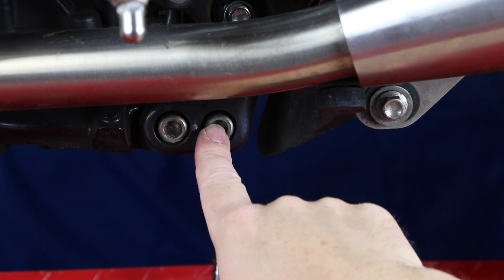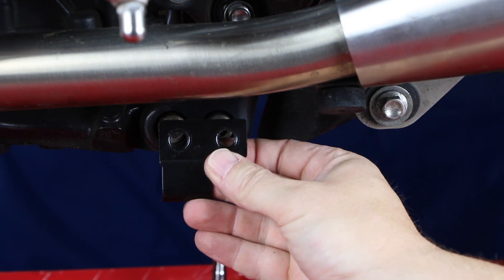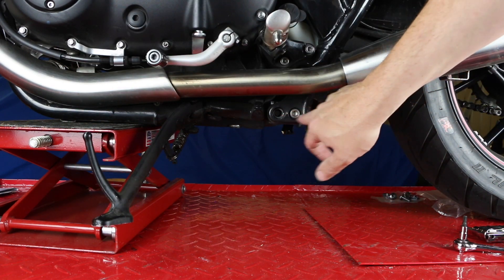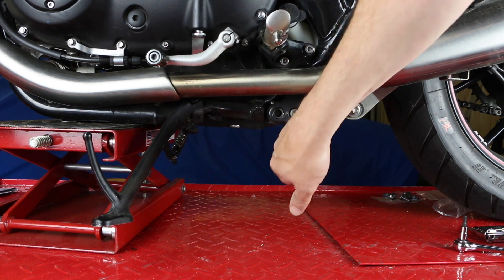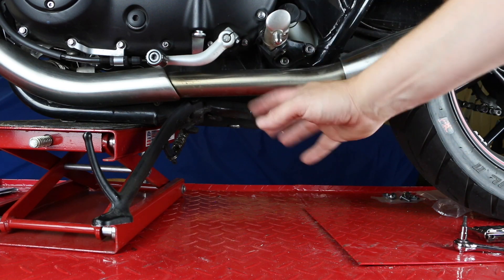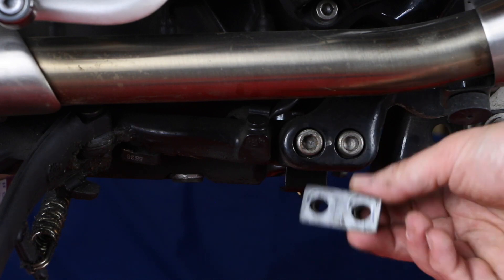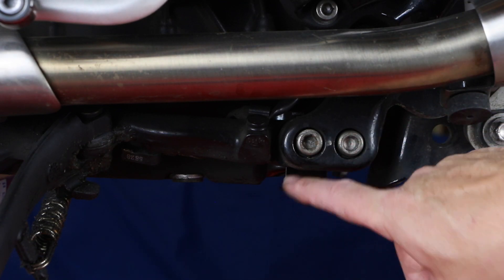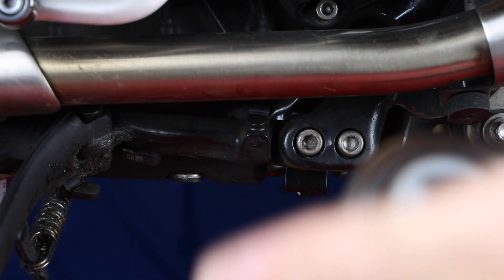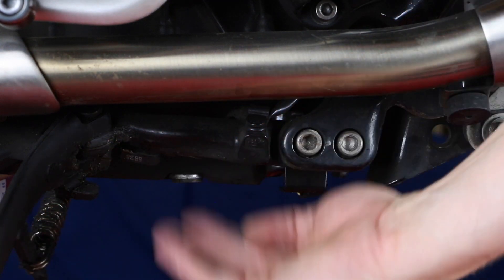On the other side it's a little bit more involved because you've got these cradle mount bolts to remove and then reinsert, but with this angled bracket replacing the captive plate on the back of that. This is where I have to retract a little bit about what I said about doing it on the side stand — you can do it on the side stand but when it comes to undoing these bolts you've got weight on that side frame rail which makes this difficult. I've just put a stand underneath it to hold it. You can find some way of chocking the bike upright just while you change this, or if you've got a helping hand they can just hold the bike upright while you quickly swap these two bolts over. So these two are back in. Ideally you want to keep the original plate in case you ever want to return it back to stock. These bolts need to be set to 40 Newton meters.